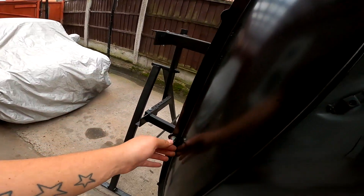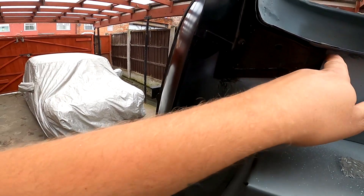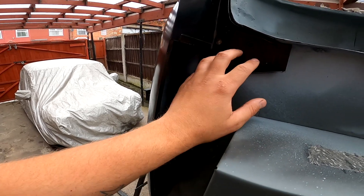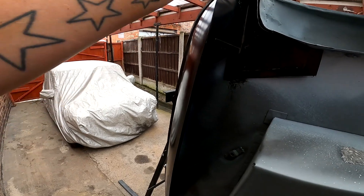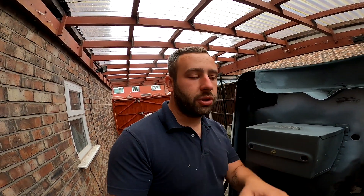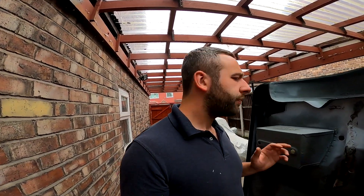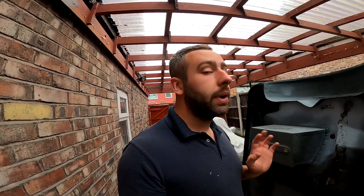The valance is all fitted on there now, bolted on at just three points. The closers are in - you can see they line up nicely with the holes. I've done a little pen mark where I need to clean up the metal. It's all zinc primed already under there. We're going to plug weld. I can't use the spot welder right now - it just trips my house constantly. The spot welder is good but it's very temperamental, and I haven't got time for temperamental. Plug welding is a little more prep, but I know I'm getting a good weld. It's underneath the car - you're never going to see it.